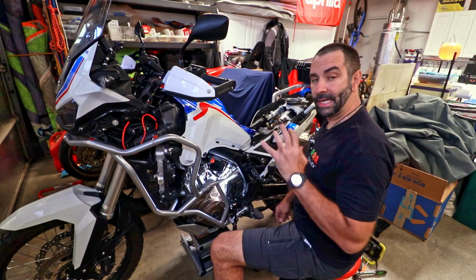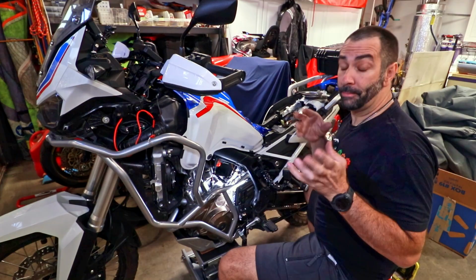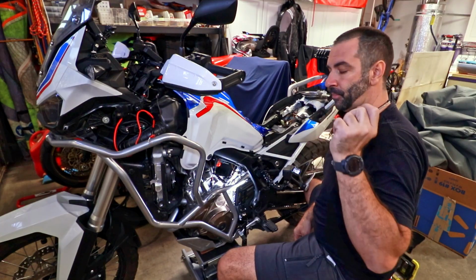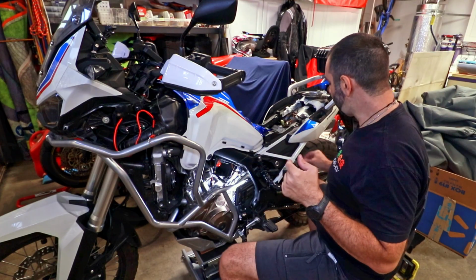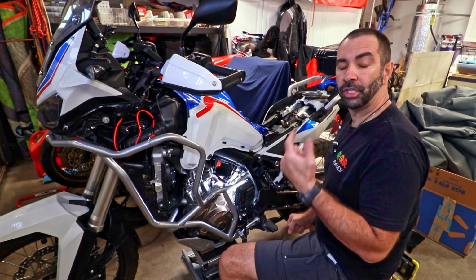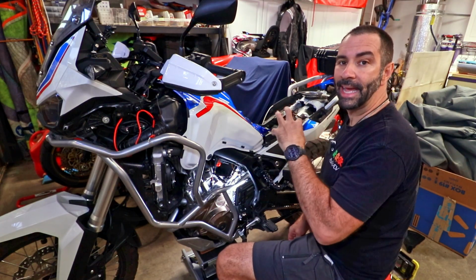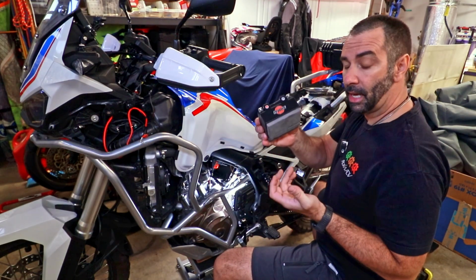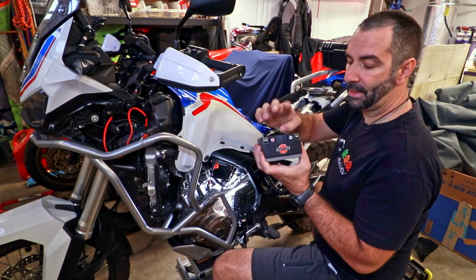In theory, with the EZ-Can, you will never have to plug anything else onto the battery itself. In my case, there are 3 wires going into the battery: the wires from the bike itself, the wire from the charger, because I have a pigtail on the side, and the wire that goes into the EZ-Can. And from this point on, everything else that needs to go in there will go through the EZ-Can itself. Shorai gives you everything you need to make it fit properly, because the battery is way smaller. And the only thing you need to remember is the polarity.